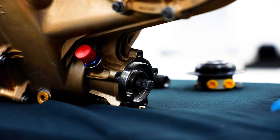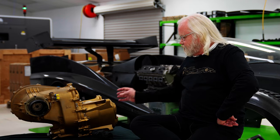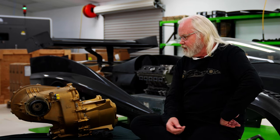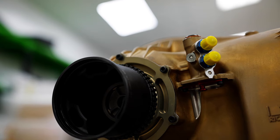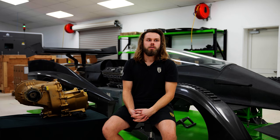It's an eight-speed drum sequential, and we use an electric shifter instead of a hydraulic cylinder and ratchet system, which is pretty unreliable. It's got a motor attached directly to the shifting drum, giving you real control — we can basically move it anywhere we like, and we can do it quickly. It's also got a valve to control the limited-slip diff.